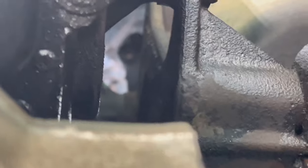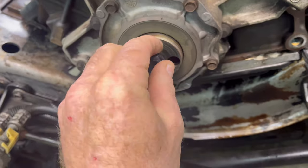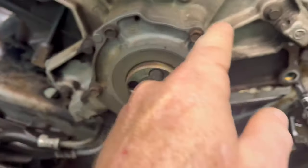And there's the bolt. Way in there. So I'll use a 14 stupid long, it goes right there. Grab the little impact and let her eat. And I like to take the balancer off. I went ahead and took it off while I had the tools so that when we wash, I can wash all this with the hot seat.